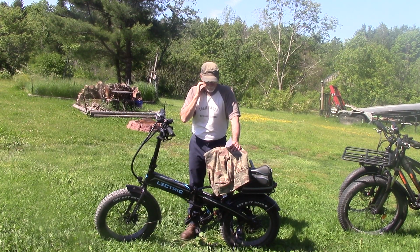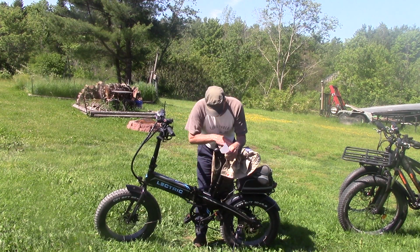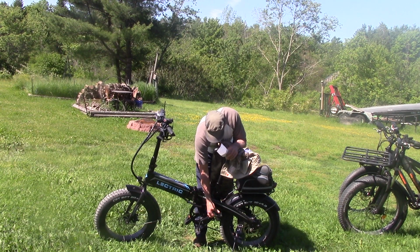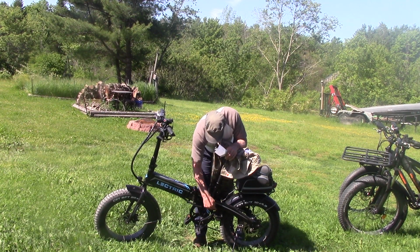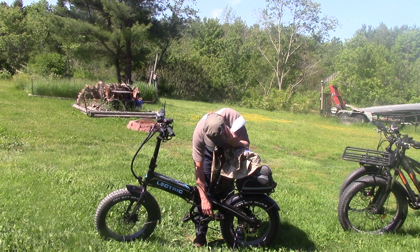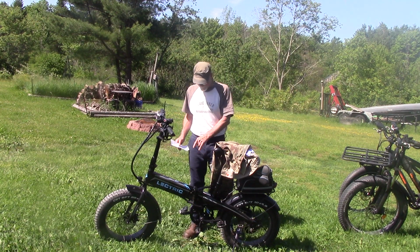Okay, check your cranks. Every time before you ride, check your pedal to make sure it's fully inserted, and it's stable. There's no movement. The way you do it on Wellgo pedals, you can't do it by the outside because the pedal's designed to move. You have to grab the inside, the meat, and check it. And most of all, you want to make sure this bolt, the pedal bolt, is inserted all the way into the crank. If not, you may have that loosen up on a ride, then you ruin your threads. Now you got to change your crank and your pedal. So check that every time before you ride.